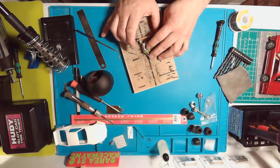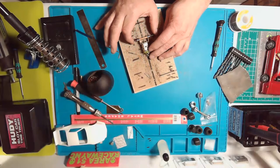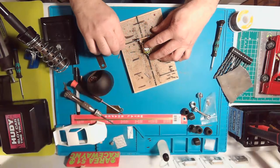No resistance. You're not going to have it cockeyed to where it's going to make the motor run hot. Because if you have any resistance, it starts heating up the motor and you start having problems. So just to ensure that's aligned. And there you go. See, nice and easy. And then when you put oil in that, it'll be easier. And this is an older axle, so if I clean this up and add oil, it'll go through nicely.